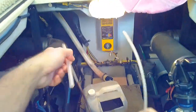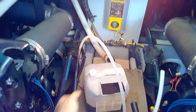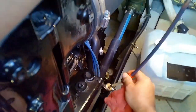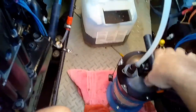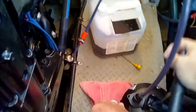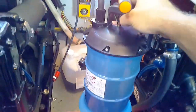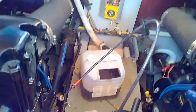We're set up now with the hard plastic sipper hose tube that actually comes with the pump kit — there are different sizes. Using the smaller end to go into the dipstick tube, you push it right down to the bottom of the oil pan, feeling the bottom, then leave it just a hair above. Let's try pumping — yes, we're definitely getting more oil. You can hear the air, so we're pretty much down to the bottom. Looks like we got about another quart.